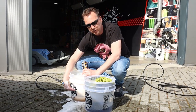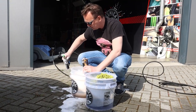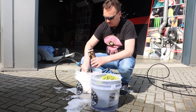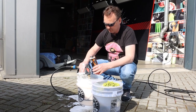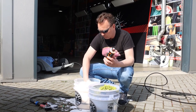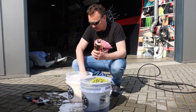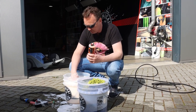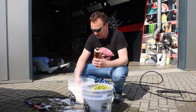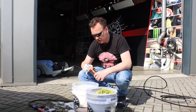What I always do is first fill the bucket half full with warm water, then add my 30 to 60 milliliters of shampoo, and make sure that the nozzle from my spray gun is under the water level. Mix it until the bucket is full and you've got a nice top of soap. You can actually feel how smooth it is between your fingertips, which gives a good idea of how mild this shampoo is. It also has some gloss enhancers and polymers in it that will help create a smooth surface after washing.